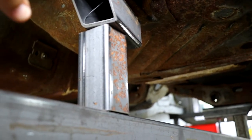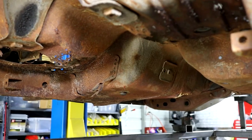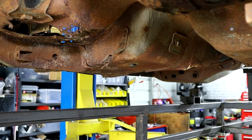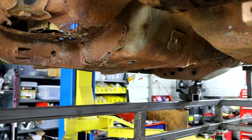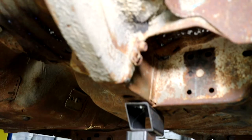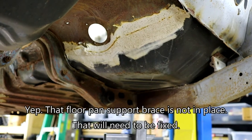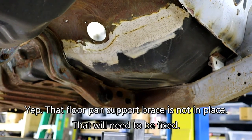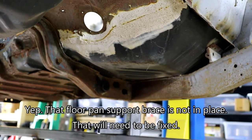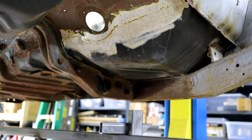The idea here is to keep this back part from moving. This is going to be a primary load bearing point. When I take out this area here, that's going to put a lot of possible binding on the assembly, so we have to rely on this area to keep everything lined up and supported for the rear frame rails. Here's a little sneak peek of the mistakes I've made in the past — yeah, I've clearly learned from those mistakes. Did some homework and studies, and I'm ready to tackle this project with a whole lot more confidence and knowledge.